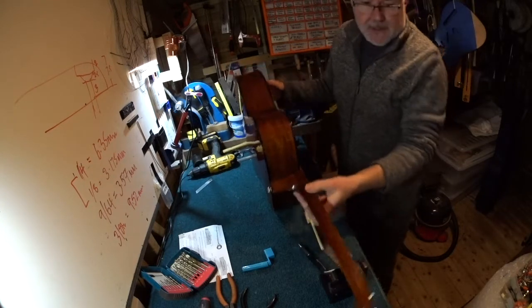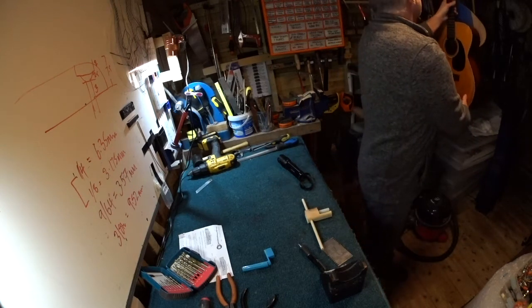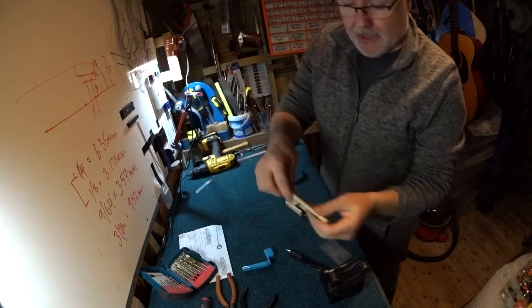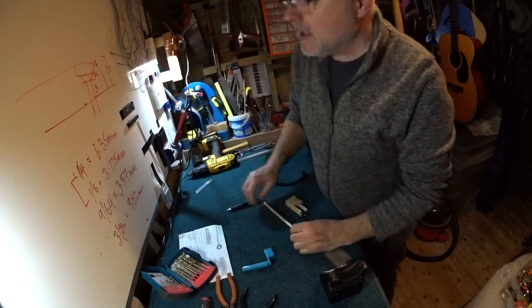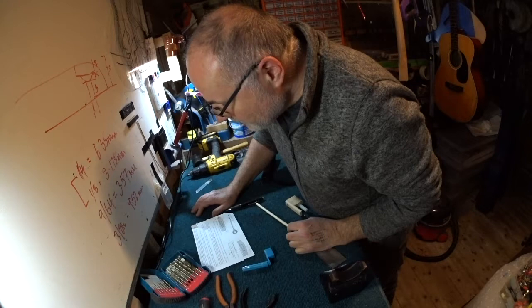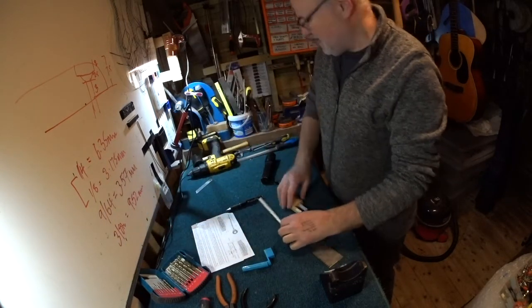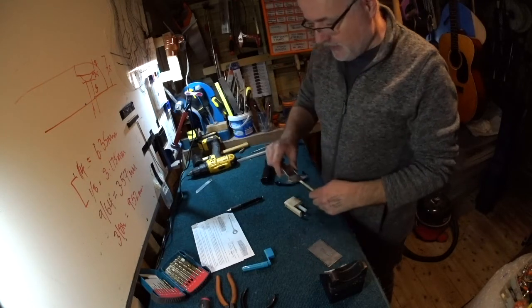Right. So, get that back up there for a minute. You look at your mark. Yes, look, there's our mark. And then it says, on this, go so many millimetres back from the mark. Move the tension and cut the rod 3/8 of an inch shorter. And 3/8 of an inch is effectively 10 mils, or 9.5 mils. So let's make up 9.5 mils.